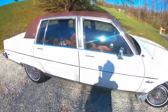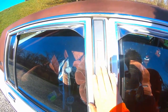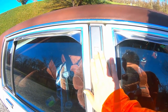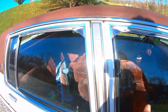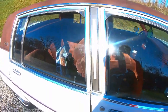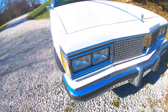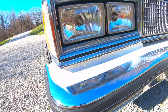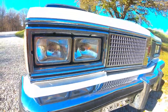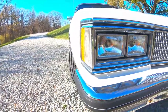We have the center lights here — they don't look that great, but I tried to do something with them because they were cracking. This kind of hides it a little bit, although it didn't lay as well as I wanted. This is just white Plasti-Dip covering it, and I have white or multicolor LED behind it — right now set to white — that allow this to light up again because the original no longer works and you can't get these anymore. It has LED conversions in the front too because the original headlights were like candle lights. I got these off eBay — they look original, which is what I like about them, but if you look closely you can see they have LED bulbs in there. It really helps at night — you can actually see the road, which this car does drive a fair amount of time at night.